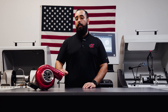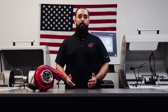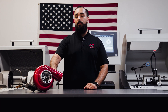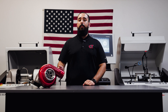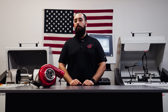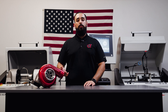As long as you keep up with maintenance, the lifespan of the turbocharger is indefinite. We recommend re-greasing your turbocharger every 3,000 miles for most typical applications, and there's no need to remove or even disassemble the turbocharger to do so. As long as you can access the Zerk fitting on top of the cartridge, you can put 7-8 pumps of grease in to fully fill it. Don't worry — there's no harm in over-filling it. Over-greasing will simply push a little grease into the turbine side and it'll quickly dissipate into a very thin wisp. The only harm comes from under-greasing it, so we recommend 7-8 pumps every time.